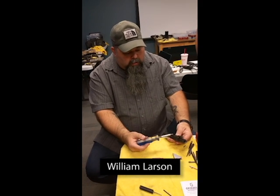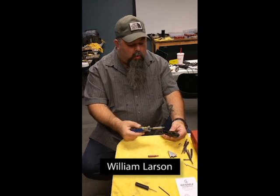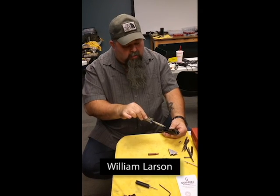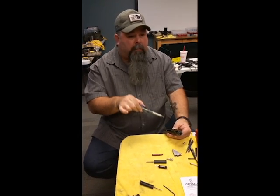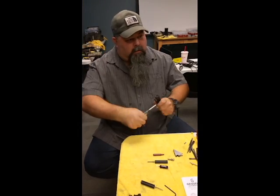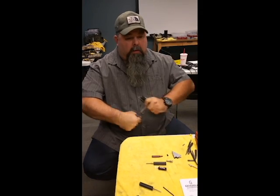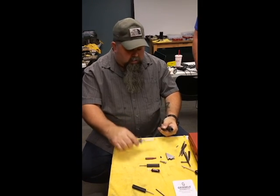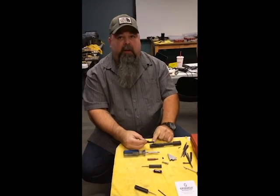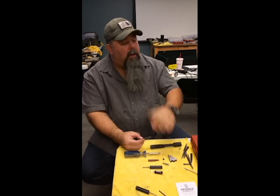My litmus test is here - when I see these fake, weak stakings. I used a tool. The torque value of 58 inch-pounds isn't very heavy, so that's why the stakings are even more important. That means I should not be able to pull these screws out readily - and there you go, there's one, there's two. Someone's gonna say 'that one's held in place' - but only one has to loosen, only one has to come out, and then you have your leakage.